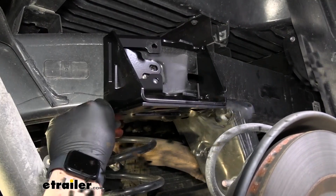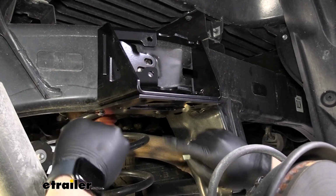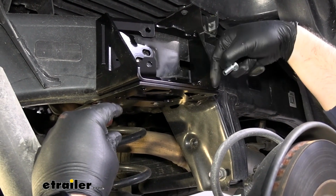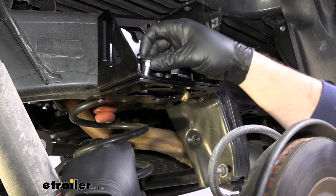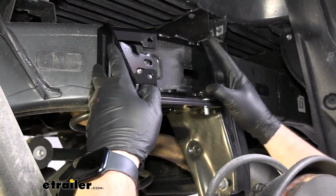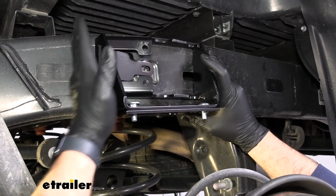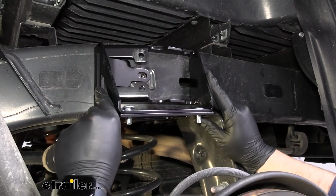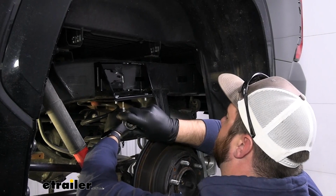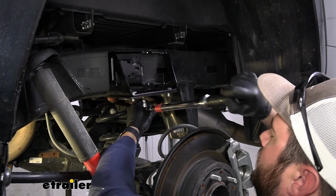Now just a tip for you guys, when adjusting this plate and aligning these holes, before you tighten these bolts, I struggled with the other side with getting these two holes to line up after I tightened this because it adjusted. Go ahead and slide 2 bolts down in these holes and then make sure your hole up here still aligns. You can see it's not really aligned now. So we'll slide it over a little bit. And now we can tighten these bolts, and I'm just going to leave these attached while I do that. And you'll want to refer to your instructions to get the torque specifications for these 2 bolts.